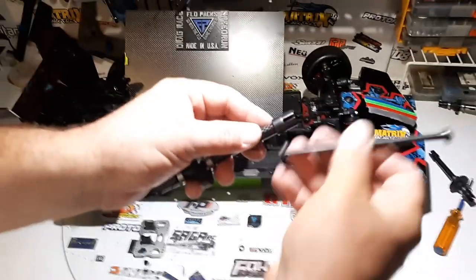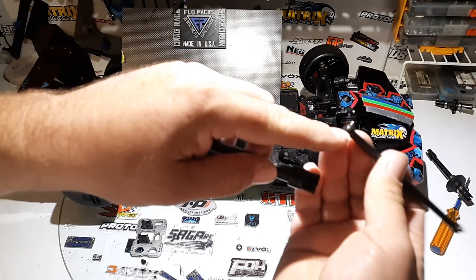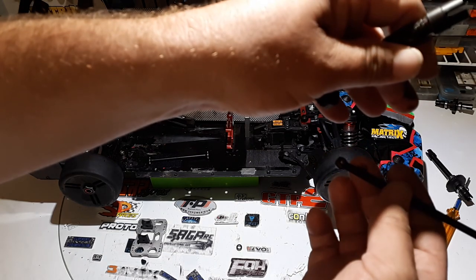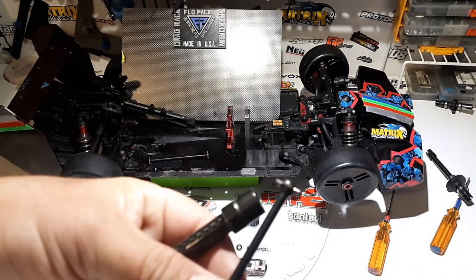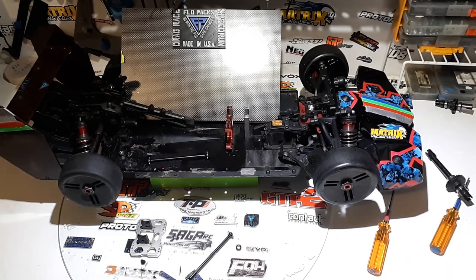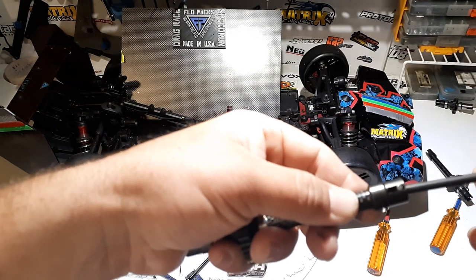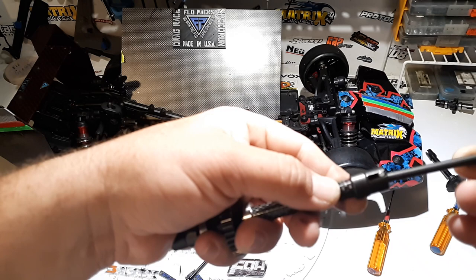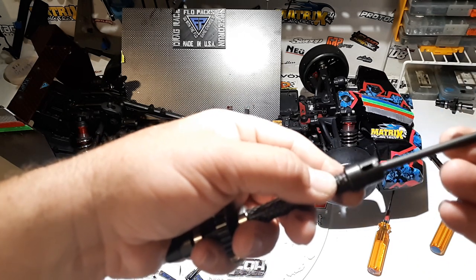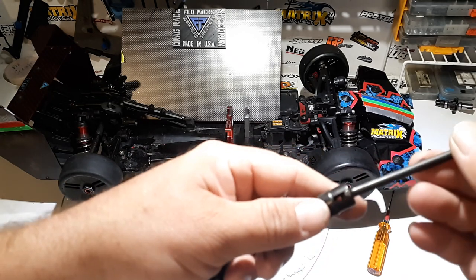A couple people told me the dog bones are tight going in. This cup is all black with no silver — the light makes it look that way. After a while it will turn silver; the powder coating on the cup will wear down. If it's kind of tight, just shove it in. There's a little stop in there — shove it in and it'll be fine. Even if it's tight, one run and it'll wear down just a little, take some of that paint off, and it'll fit perfect.